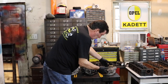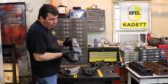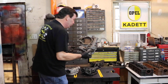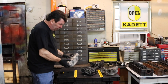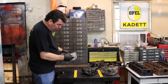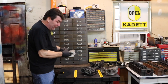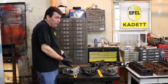This one here is a '75. This is for the early fuel injection. As you can see, no fuel pump. It also has a little pointer so you can actually set and do a timing light mark on your pulley, which is the only one I've found so far that actually does that. This is a 2.2, just like the other one. But its difference is that it had a port here that's not used for anything that I know of, other than some diagnostic on the 2.2 fuel injection as I've been told. I've not seen that so I'm not exactly sure what it's for, but it's not for the fuel injection itself because there's nothing that goes there.